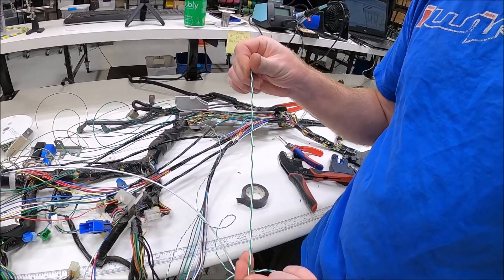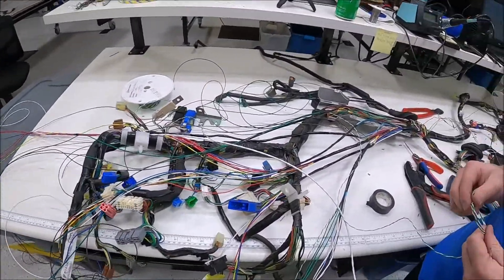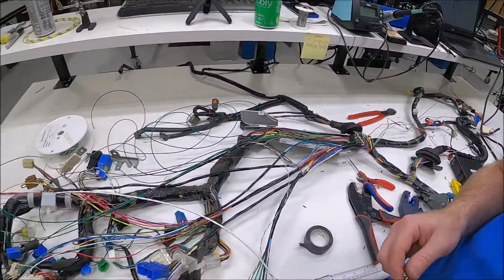So this pair of twisted wires is known as CAN wiring. This is only present in newer cars — it started in 2005 with the Legacy GT and Outback, but as car features got more advanced, Subaru started adding in CAN wires. These make it a little bit tricky when you're doing a swap, because instead of having individual wires for each input, you're getting all these digital signals on just these two wires. So if you remove those two wires or it's not getting the right digital signals, the car is not going to work properly. Basically, two wires replace a single input or output for many different things — you're sending a ton of information down these two little wires.